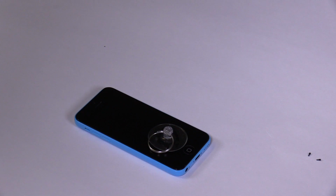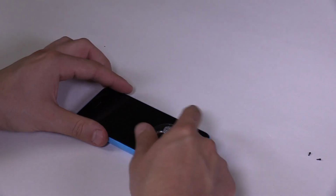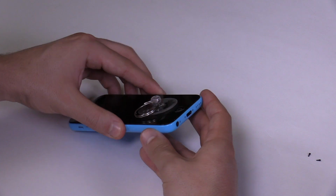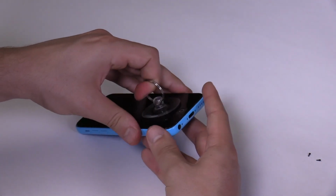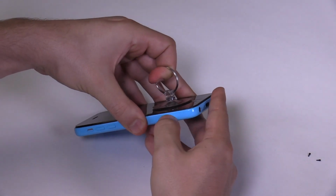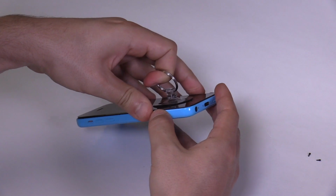If your glass is broken, the suction cup might not latch on. In this case, you can either apply Scotch tape or a plastic film to the broken area to create a smooth surface. Once the suction cup is gripping the glass, pull it slowly and steadily to create an opening at the bottom of the screen, and sometimes the glass can come loose from its plastic frame. If this happens, we need to use a different technique to lift the screen.